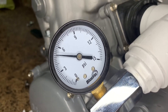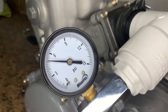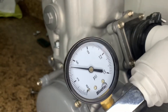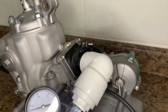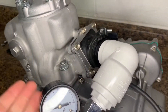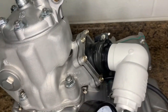I'll put about five PSI in here — this motor is good, so you'd see it dropping right away if there was a leak. I'd set a timer, put it on for a minute or two, and record what the drop was. To find the leak, you get a bottle of soapy water. First, test all your fittings to make sure it's not leaking from the leak down test kit itself. Spray around the rim of the exhaust and intake clamp.